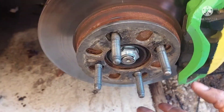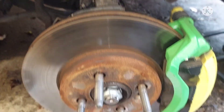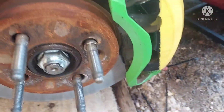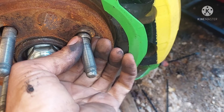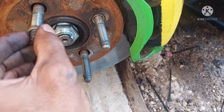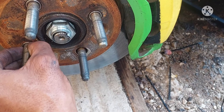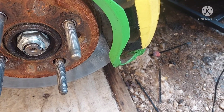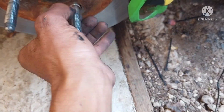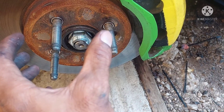Alright, I'm back at the car. Take this wheel spacer off — these actually fit right in there. Like I said, this was not my idea — this was me watching Keepin' It 1 Lucky, and they were doing a big brake upgrade and saying how important this is to keep the rotor. You can see how I was just able to adjust the rotor on there itself. This takes out all the slop from the rotor, so when you go to hit the brake it doesn't pivot first before it actually starts braking.